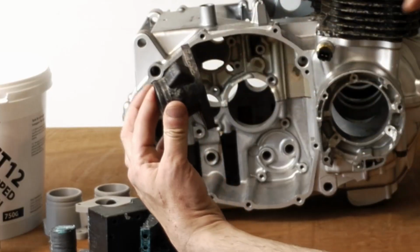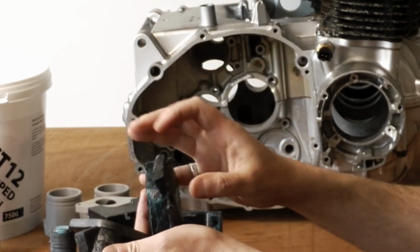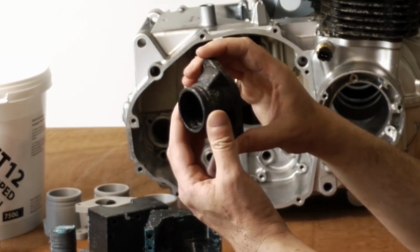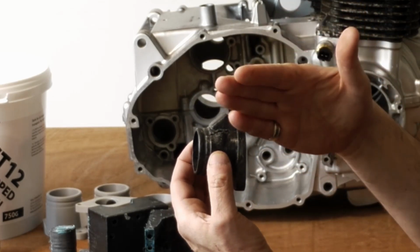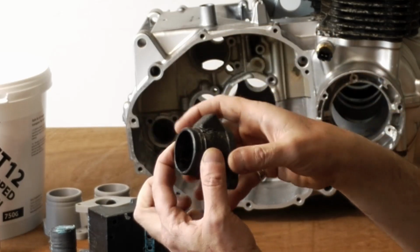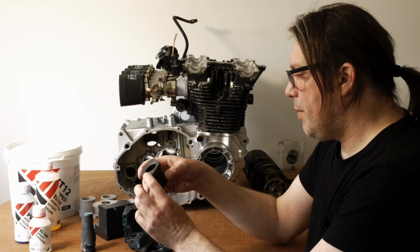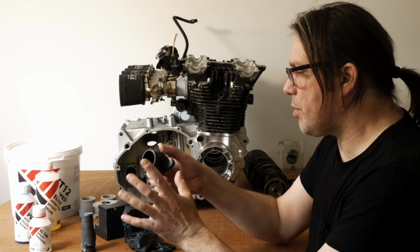Plus, I was compressing it from this side. That was the closer. It's now distorted beyond measure. But it was closing from that side. And I think these flat surfaces didn't provide much movement of the carbon fiber to go in and fill the rest of the cavity up. So yeah, partly the mold design, partly I think an excess of carbon fiber, but even so there were still a few voids on the surface, but I'm not too worried about them.